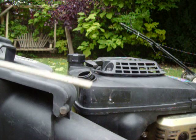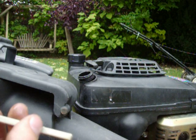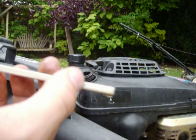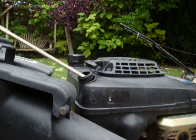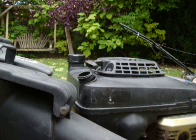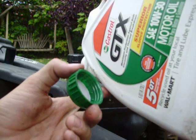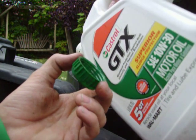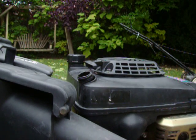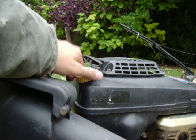You have to be careful when replacing your oil because the oil is very clean and it's really hard to see on the dipstick — you have to look at it in the sun. It's right here — really hard to see. It needs just a little bit more. Most lawn mowers take about a quart to a quart and a half. I've had them take two and a half quarts, but that was a big engine — my V-twin. That's about it. Don't overfill though — if you overfill you can blow your engine and totally blow all your seals.